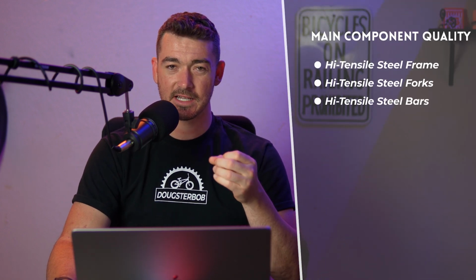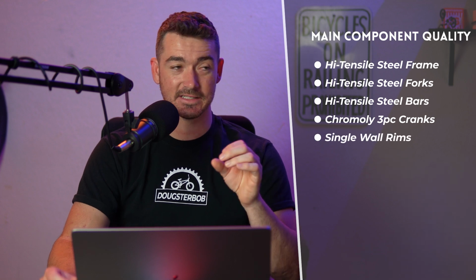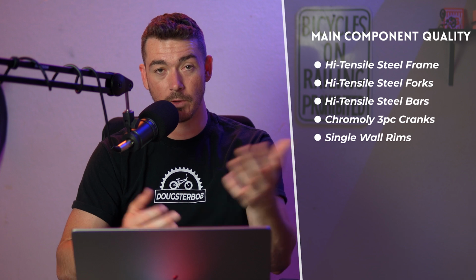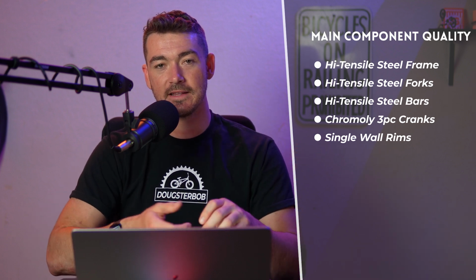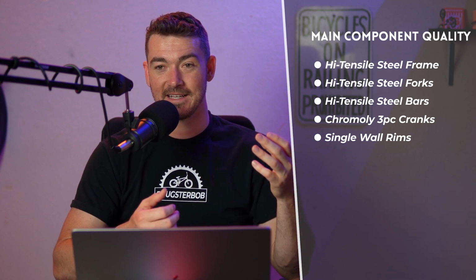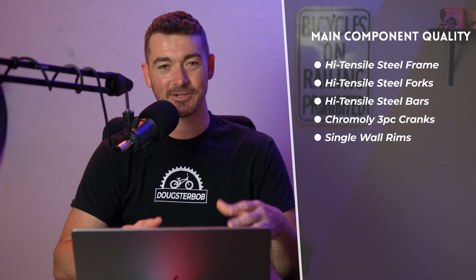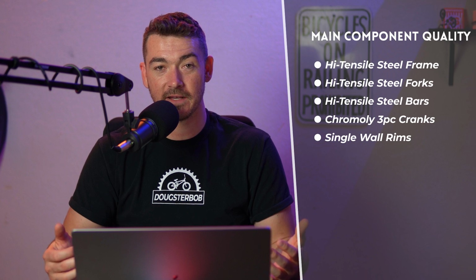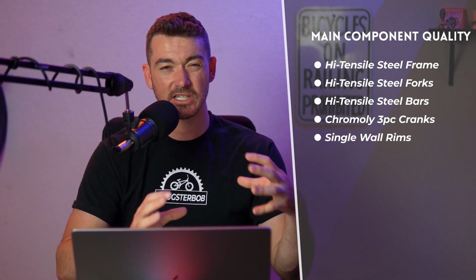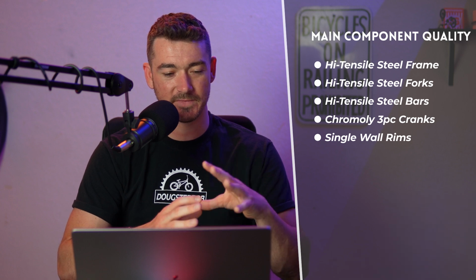The star cap inside the forks is a pain because when you tighten that too much, it just pulls the star cap up out of the forks. So when you tighten that star cap too much, it's going to yank right out of the forks. And I've had this happen a handful of times early on the bikes, and the only way to fix it is to buy new forks. And that is the most frustrating thing ever. So it's just a cheap way that they make the forks, it's not the best.